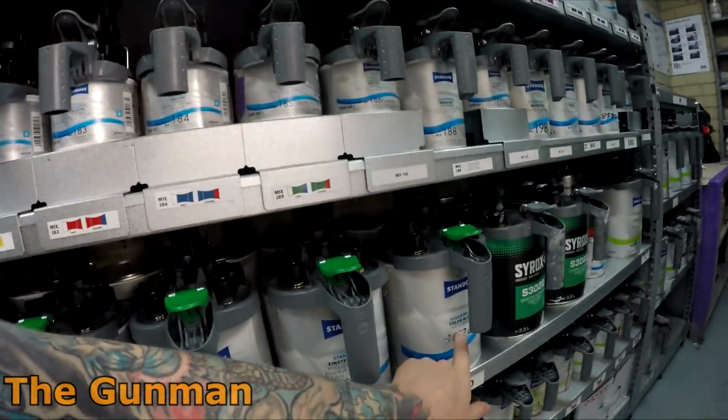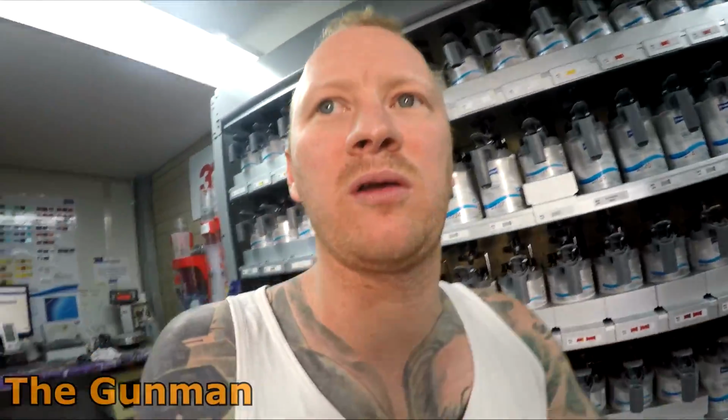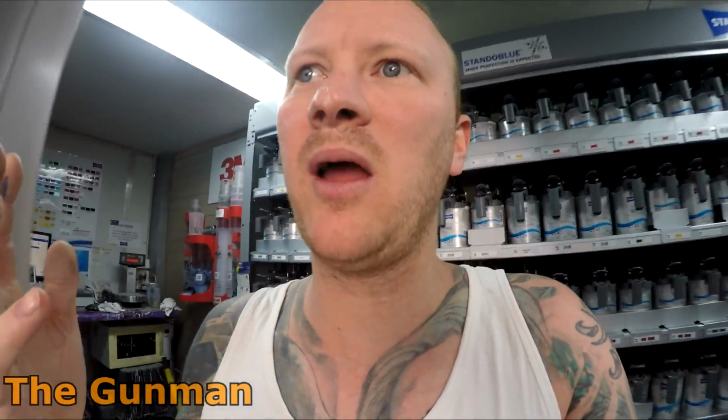They're like, man, if you need to spray at 1 bar or lower pressure, you can. Just add a little bit more of the base coat blender. If you want to spray it like solvent, say if you've got a spot repair, you don't actually have to smash it on with really high pressure or anything like that, because that's what I was finding. Previously, because this stuff really does float when it's in the gun, if you want to spray at 2 bar, you can.